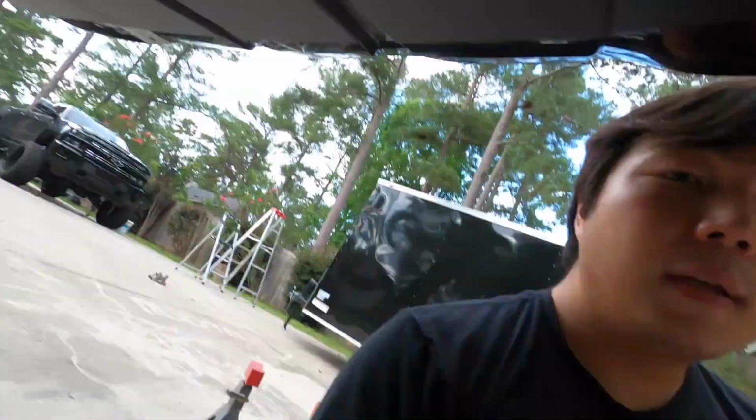One thing I did forget to mention is do not paint out of the can. Do not start painting with the can open, because the way the stuff dries is a lot different than your conventional paint. It actually dries better when it's humid. You want to pour the amount that you want to use in a separate cup, and then close the lid as soon as possible, because you do not want that stuff to be exposed to humidity for a long time, because then it'll start to activate inside the can and you'll waste a whole can of POR-15.